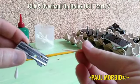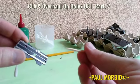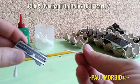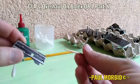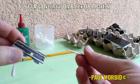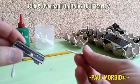Here's something I want to show you. I'm scraping off of the filmgate — take a look at that if you can see it. That black right there. There's more to come on that. Dust, dirt and especially some of the film particles. That's what you want to get off to make your Bolex run more smoothly and get a better image.